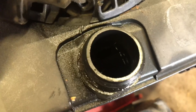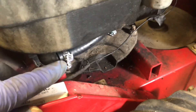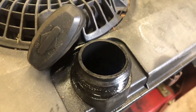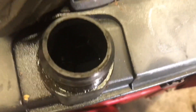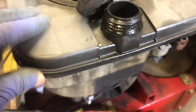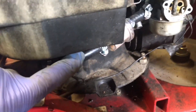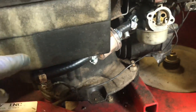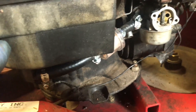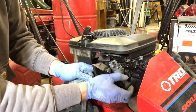These tanks are very difficult to actually see down into and check if they're clean. I drained the fuel a few times out into a pan and there were no chunks - it looked nice and clean. But that doesn't mean anything - there could be a chunk you can't see because of how the tanks are made. So when I was done with that, I put a new line with a filter going to the carburetor - that should stop any other little chunks I missed in the tank. Now we'll put the air breather on and see if it'll start.